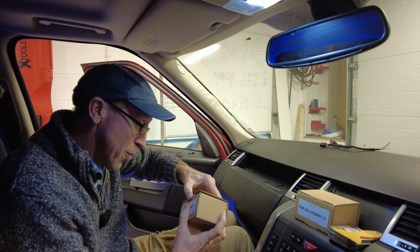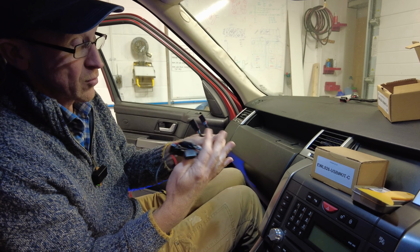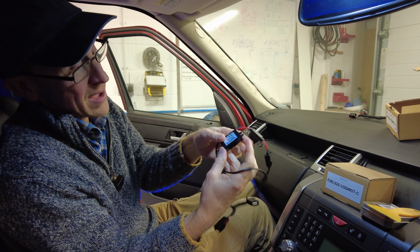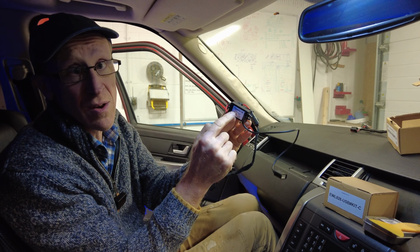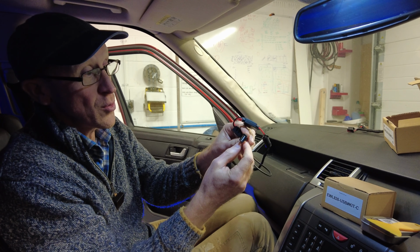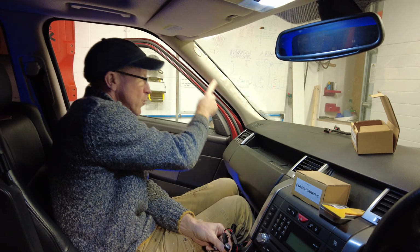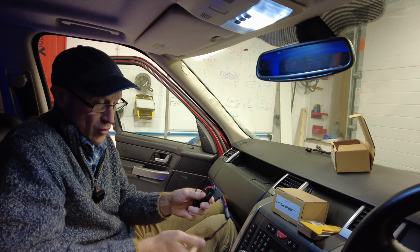Right, or you could buy one of these kits that we've pre-made for you. So you just plug it in there, then it goes through an inline fuse, through a power converter, and gives you a USB, which is 5 volts. So this little brick here is converting from 12 volts to 5 volts, and you've got a USB-A. So if you've got a USB-A powered dash cam, because a lot of them go off a cigarette lighter or a USB port, rather than having to run your cable there, you can just do it all locally up here, much neater, and you're not using up a power supply.